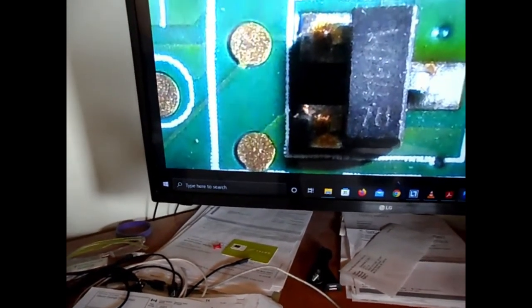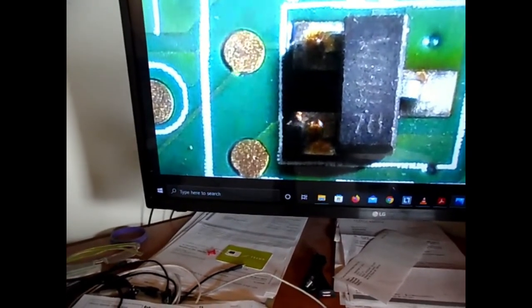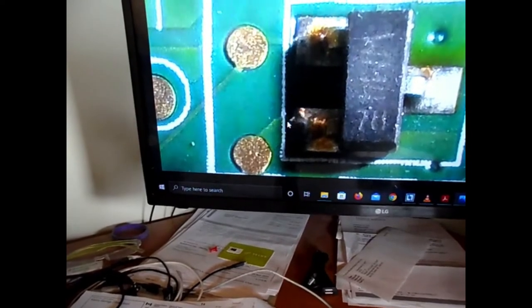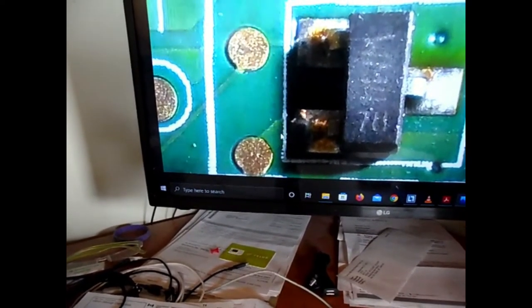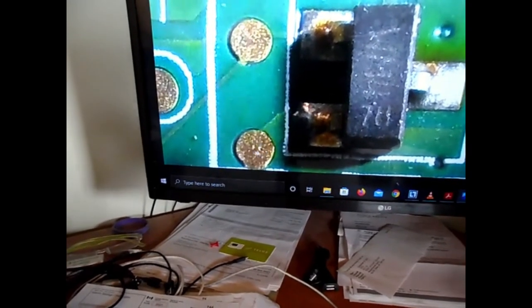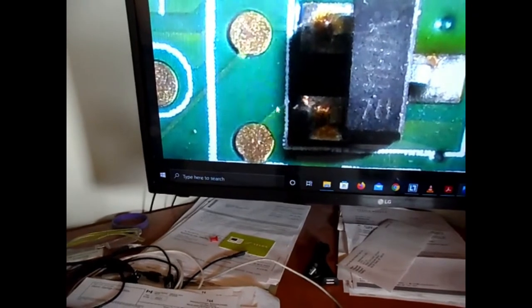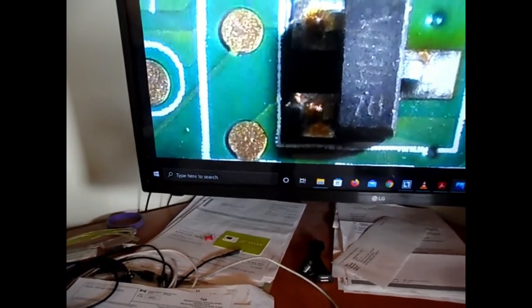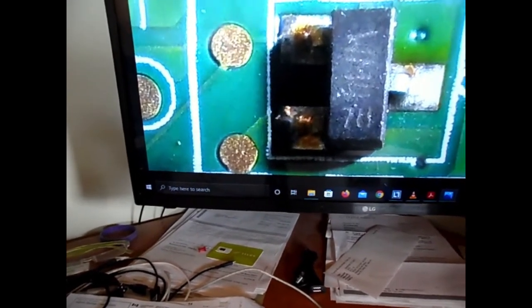And the reason I say that is because when I desoldered this chip and took it off, I accidentally pulled this pad right off the board. All you have to do is take a little razor knife and scrape off some of this green stuff here, and then put bridge solder. You can bridge solder either from here right across to the new chip leg, or I scraped and bridged it right across the whole thing, made a solder bridge right here. So just be careful not to rip a pad off. It's easy to get too much heat and have these pads come off.